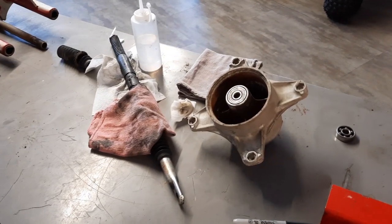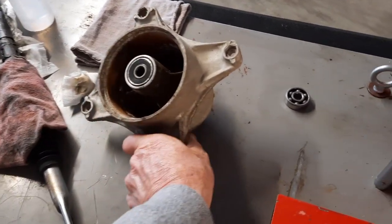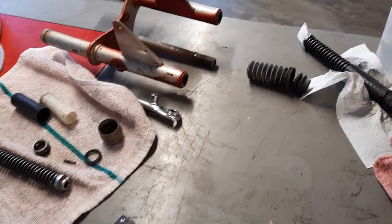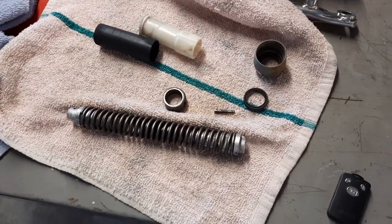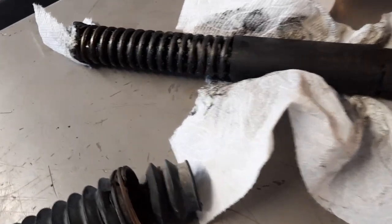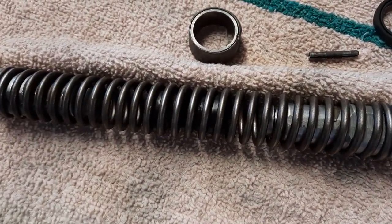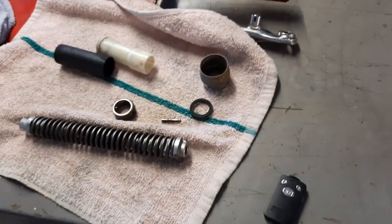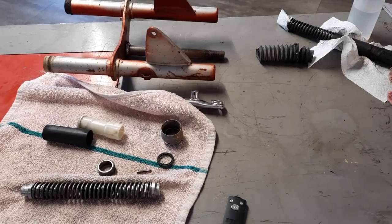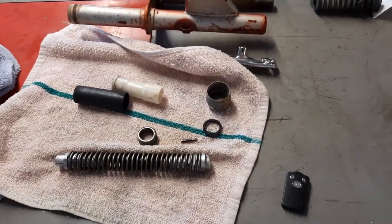When we come back we're going to start with plating — we've got a lot of bolts to plate. I've got a trick that Peter taught me about this bearing. The parts are coming so I can't even put the forks back together yet, but I can certainly clean them all up. Here's a before — really nasty — and after. We're going to put new seals in this, but this does not have fork oil; you just grease up the sliding areas real good and the seal keeps the grease in. That's all it is.